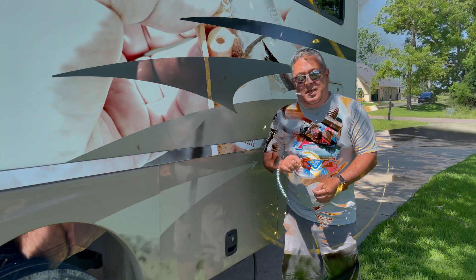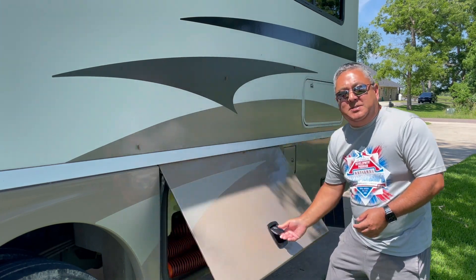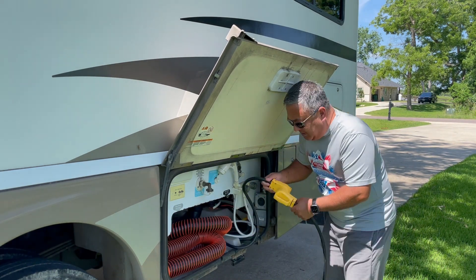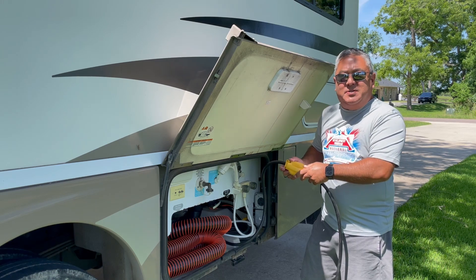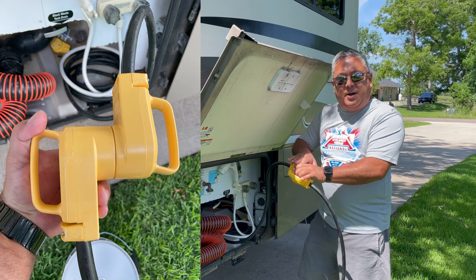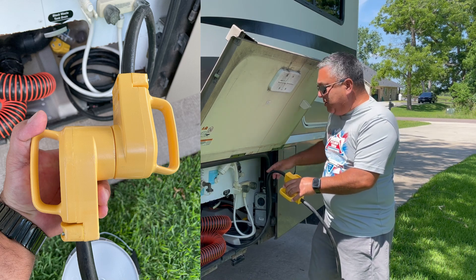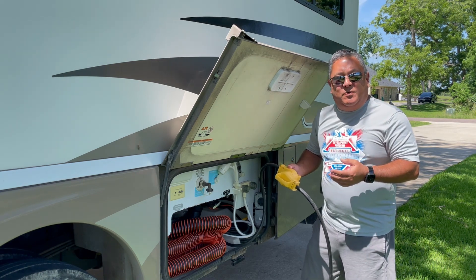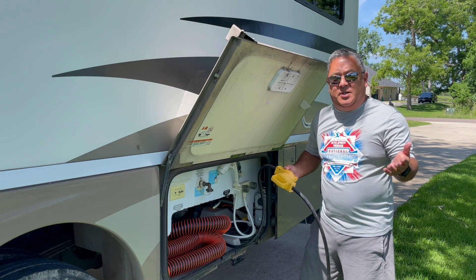I was able to go ahead and redo the new plug just by cutting off the damaged section — something you need to check every time you go out on your rig. I've already replaced both ends. This is a 50-foot extension that goes to a plug we have inside the garage. I used two brand-new Camco receptacles — male and female. This part goes into the RV; the other part is the extension cord. We replace these every once in a while, especially when we start noticing damage like what I just showed you.